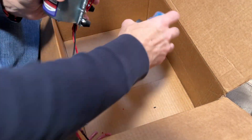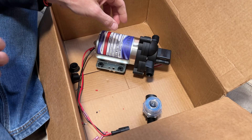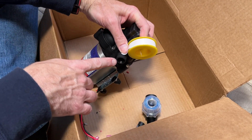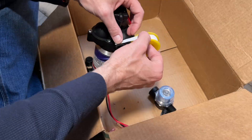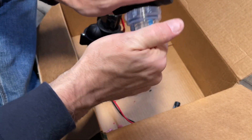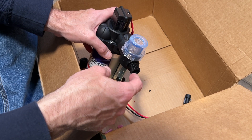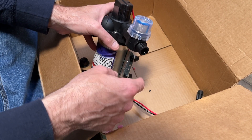The next thing I need to do is install the strainer on the inlet side — it threads on there. Before threading it on I'll put some Teflon tape on it, winding it on clockwise. You want to make sure you don't have it near the edge of the fitting and don't have a bunch of extra tape on there, because you don't want it to get sucked into the pump. Make sure the strainer is tight. I'm going to reuse the fittings already on the camper — they already have rubber gaskets, so I'm not going to put Teflon tape on those fittings, but I will check them for leaks after I have water in the system.